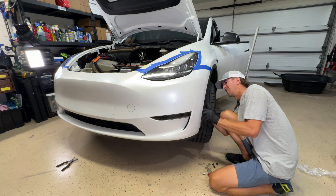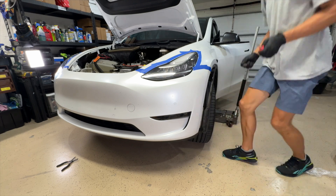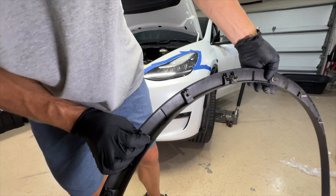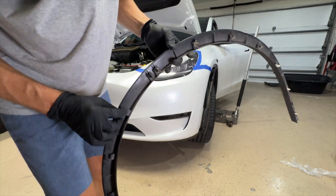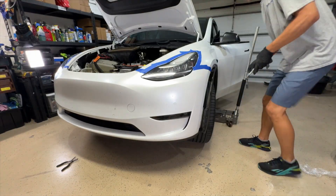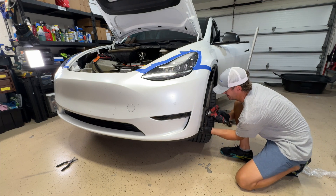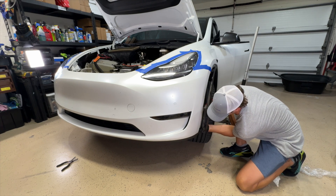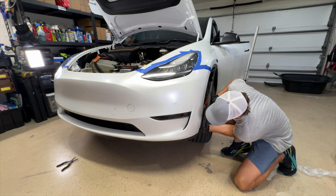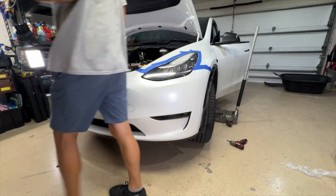Now this is what's different between a Model 3 and a Model Y — it has this plastic trim that goes around the fender well. Now I'm showing you here the clips from the other side, the pins remained in place. And now I'm on to taking out the nut underneath the bottom of the fender. I left this fender piece in place and later on you're going to see I'll just go ahead and remove it — it's just the rest of the clips.